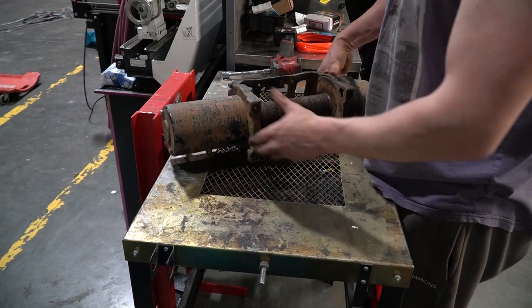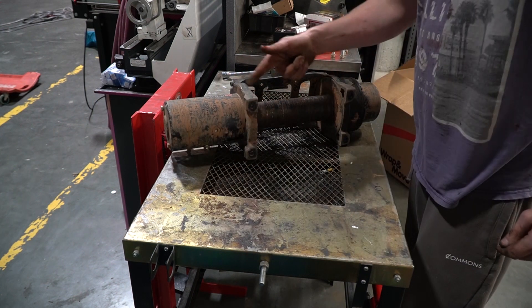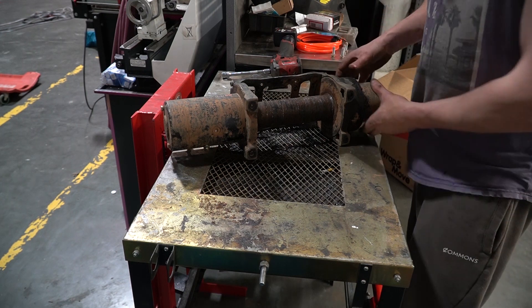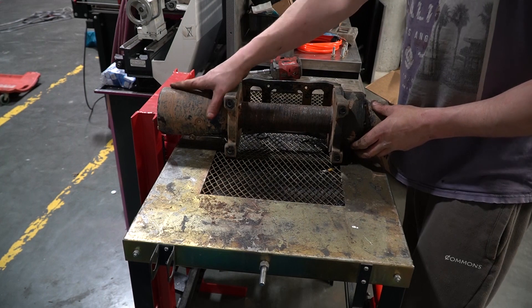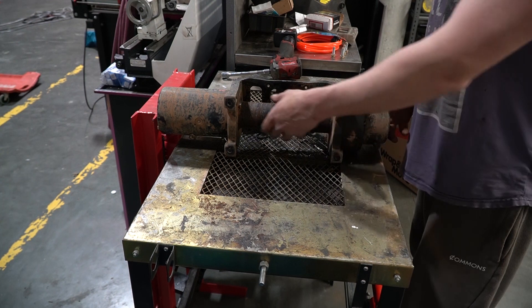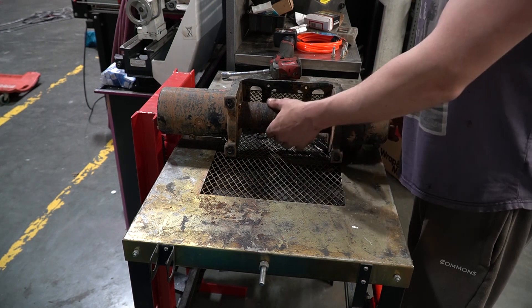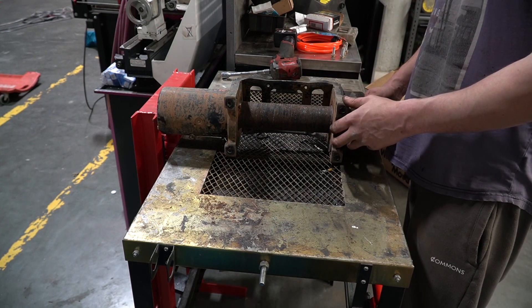So that's the main body of the winch looking nice and crusty. This side's the motor. If it's the same as any of the other ones I've done, there's a spindle running through the middle that operates this reduction gearbox. So this will spin at like a thousand RPM, which will then get reduced down and you'll end up with the slow spinning winch like you normally see. Now this is going to need quite a lot of clean up because it's pretty rusty in there. So let's find out how deep this problem goes.